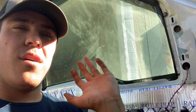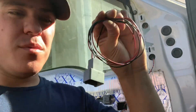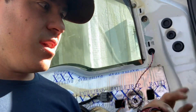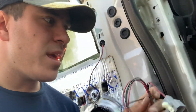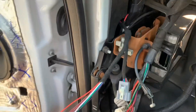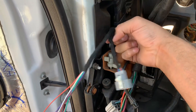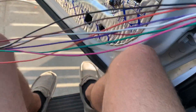The green and purple wires control the fold motor — that's what this pigtail plugs into on the fold relay. It's got power and ground. We need to run that power and ground and pin these into the plug accordingly. Then we'll start running wires to the other side for the passenger mirror. This pigtail is probably the easiest thing you're going to do. Got the pigtail for the fold relay ready — it'll just be sitting there ready for the dash to come in so we can plug it right in.